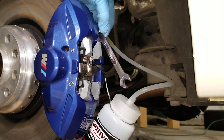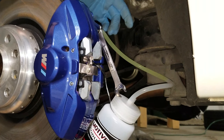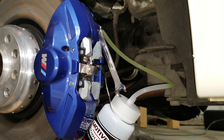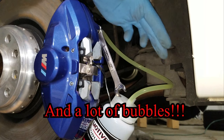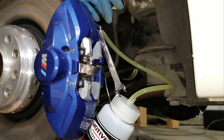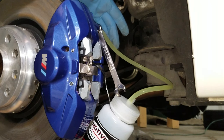Because the brake system is pressurized from your power bleeder, if you open up the bleeder valves too far, brake fluid will actually flow through the threads of the bleeder valves and drip on the back side of your brake caliper. The fluid is starting to drain slowly. I can tell this is that greenish color fluid, and the RBF 600 is more of a yellowish fluid, so all you have to do is watch the line here and wait for the color change.